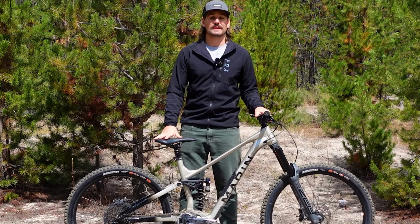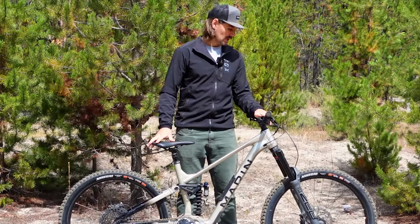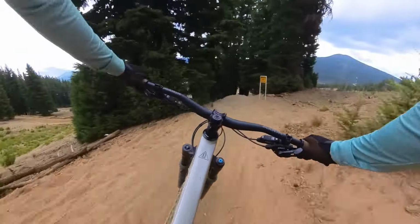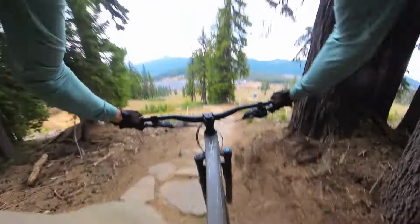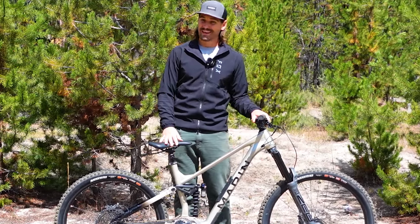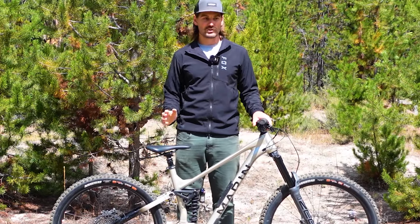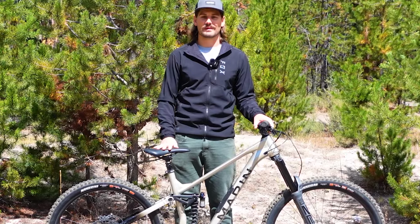Speaking of underwhelming, the Alpine Trail XR came with a pair of in-house Marin wheels. They did hold up fine over a few long days at the bike park, but I'd imagine after an entire season, they would be pretty dang shot. They also have a pretty low hub engagement. I did some caveman math of just rotating the cranks one full rotation, and it seems like it's probably about 16 degrees. You definitely notice that, trying to fit in some pedal strokes between jumps or sprinting out of corners, stuff like that.